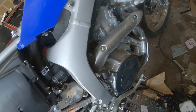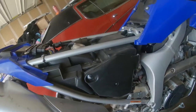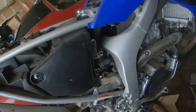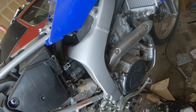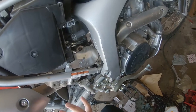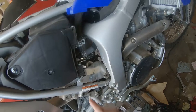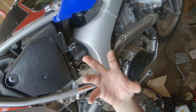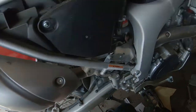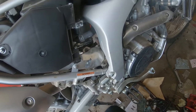Alrighty, and we're back. So let's try and peel this rear shock out. On most bikes I've worked on, I'm used to pulling the entire subframe, airbox, whole shebangity bang bang. And I did a similar job like this on a CRF 250L. I talk about those crowfoot adapters. Unlike the Yamaha, Honda has bolts on the other side. Yamaha has these flat-sided stoppers, kind of like on axle pinch bolts, or axle bolts.